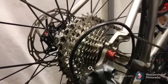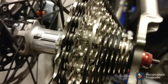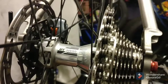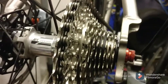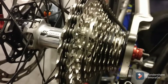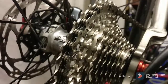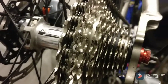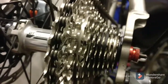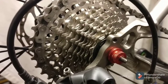Here we have the cassette on. It's not yet finely tuned and I've yet to do the shifter. But the cassette seems to fit in quite nicely — it just pushes the parameters of the existing Shimano. So it does fit. It does go through the gears, a bit clunky at the moment because I've got to tune them up, and it won't go into the large ring because I've not set it up — the old ones were on small ring to 11th gear and now we've got the 12. So next is to strip down the shifter and hopefully get it working.